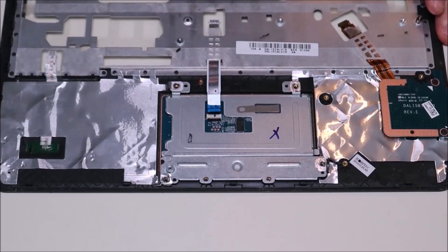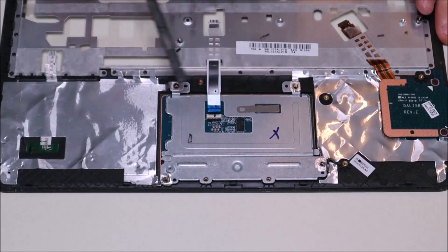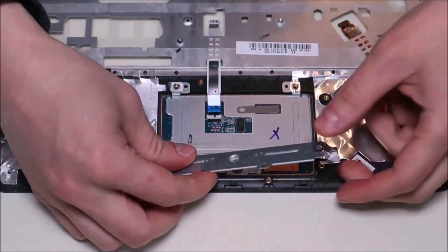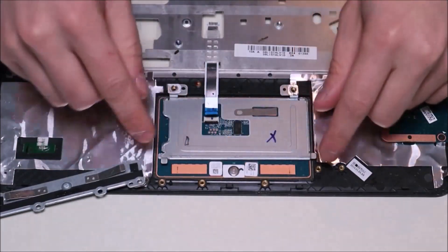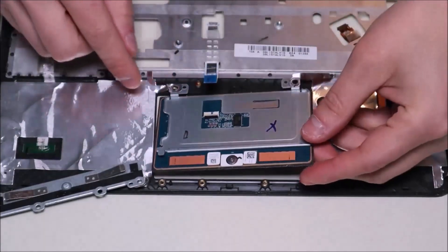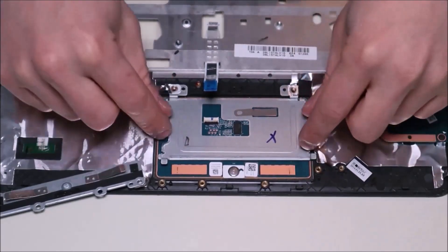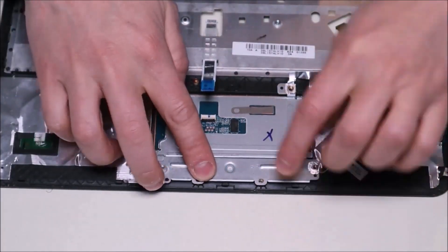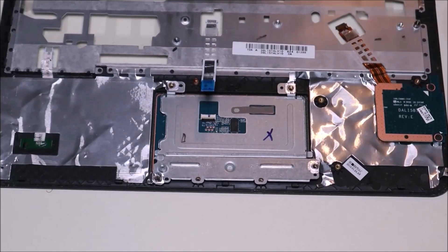To get the rest of the touchpad up, you'll see bright silver stickers stuck on top — you have to fight the sticker. Peel this up here and that breaks the sticker a little bit, then it comes loose. There are your mouse click buttons and the click feature, and this is the rest of your touchpad. It's stuck there so you can just rip that up if you're replacing it — it's not going to hurt anything. To get it back down, set that into place and bring the shield back over, get it underneath that clip, and set it down in place.